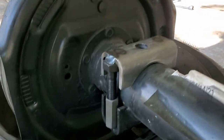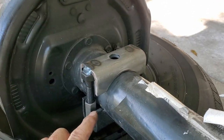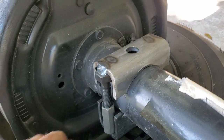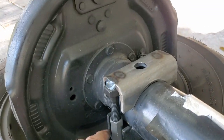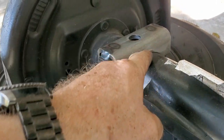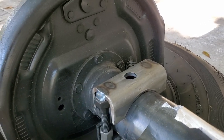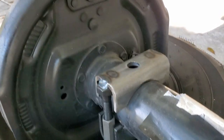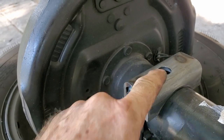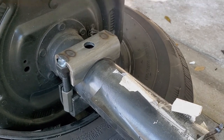Here's how these perches go on. They welded some bolts on here with standoffs, and they're adjustable. To get the perch exactly parallel with the other one, you measure the gap on this side and that side and adjust until they match. The perch also transfers any rotational force down to the factory-installed bottom perch, making it a really strong setup. I'll put a tack weld here and here — the standoffs let you get perfect alignment for parallelism and transfer rotational torque. You can see the index hole for the leaf spring, so it's hard to mess up. I'll get these measured and welded.